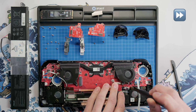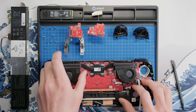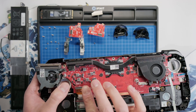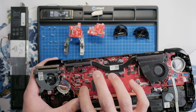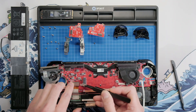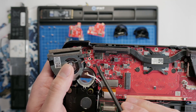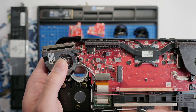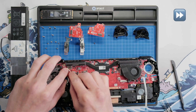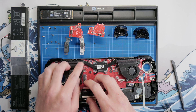The last screw we took out of the motherboard will be the first screw we put back in, then we can reinstall the right fan screw. Peel off the left fan again so we can reinstall our LCD and Wi-Fi cables. Make sure the connector lock is up, slide the ribbon cable in, and then lock it down. Then take our insulating tape and reinstall it over the connector. For the Wi-Fi cables, their positions on the motherboard are marked with a white W and B so you know which wire goes to which port. Go slow and take your time reattaching these — they can be a bit finicky. Reinstall the fan, run your finger along the tape to secure it, and then put the screw back in.